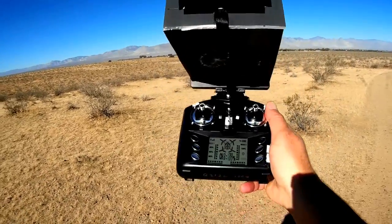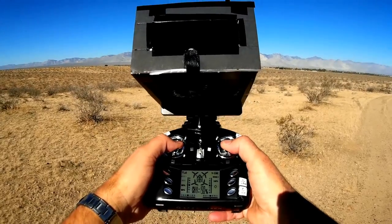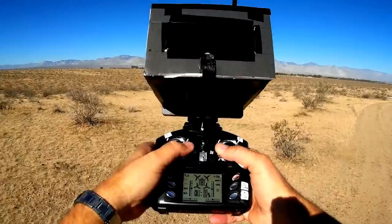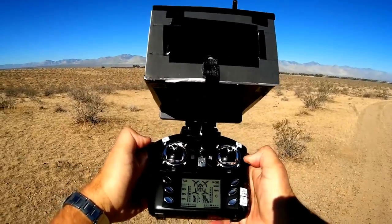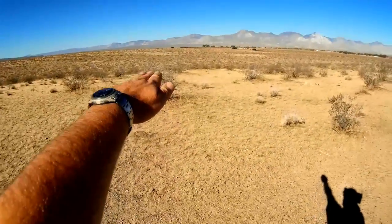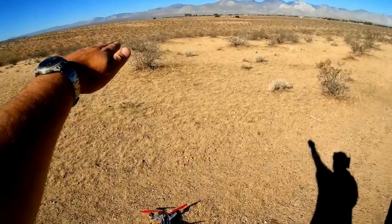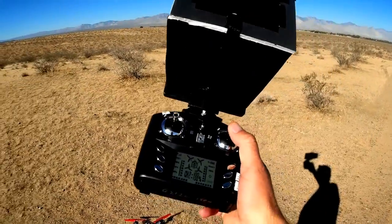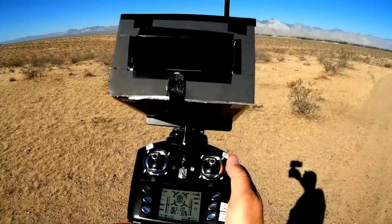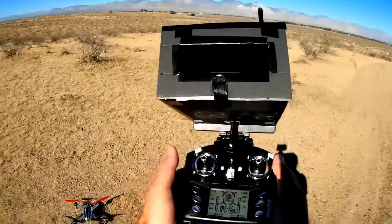An alternate way to take off is to simply bring down the pitch and the throttle and either move them inboard or move them outboard, and then immediately release them. What that'll do is the quadcopter will automatically take off and reach a level of about 1 meter and then maintain that altitude. Of course, you're going to have to maintain its position using the pitch roll stick. So that's two ways of taking off. Similarly, there are two ways of landing.